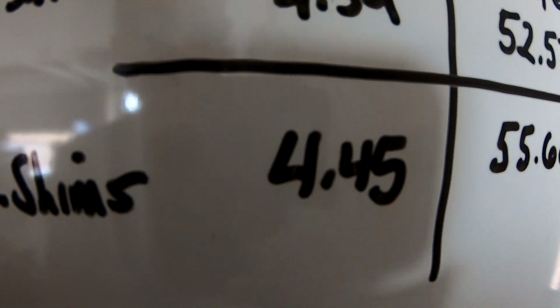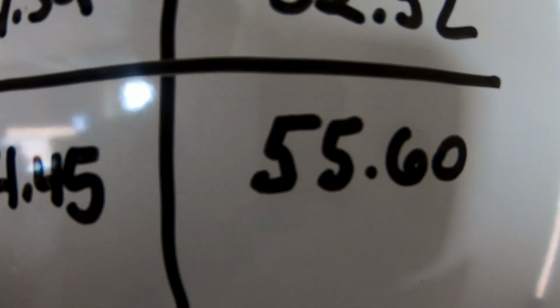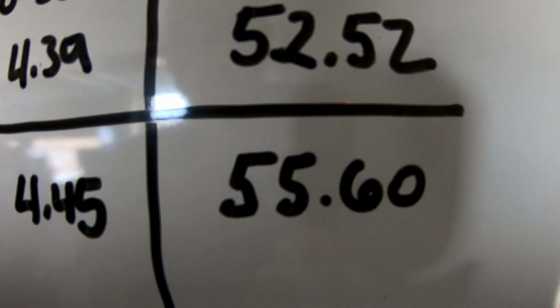I mean, you really can't tell on the bike the difference, but man, it gained a lot of top speed, 55.60. So the valve shim's definitely what the Ghost needed. It goes all the way to the top RPM or maximum RPM with no drama, no valve float, and it was quite a bit faster. So for just a few dollars, it's definitely a worthwhile mod on the Ghost.